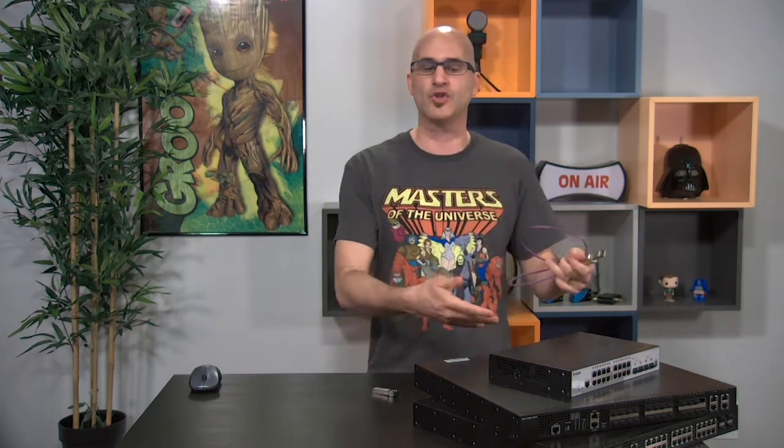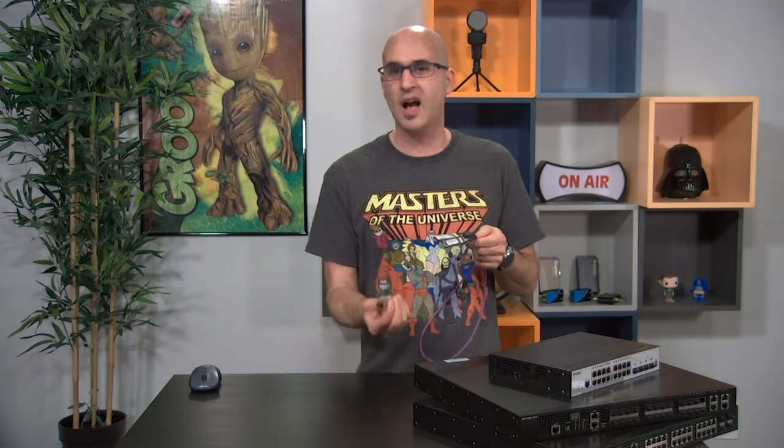You also have these little cables here. These are the same type of transceivers but they've got a copper cable connected to them and it's locked in at whatever length it comes. These are great for wiring inside of racks — so if your storage or your transmitter/receivers are in the same rack, you don't have to buy this expensive dongle. You can use one of these less expensive dongles, and these are actually about ten to fifteen dollars depending on the length and the speed, compared to a couple hundred dollars and up on the fiber transceivers.